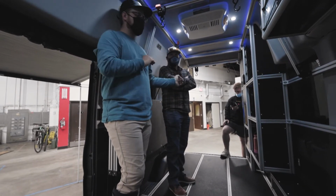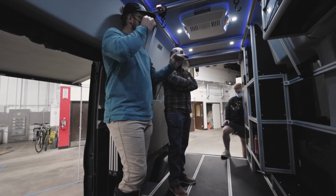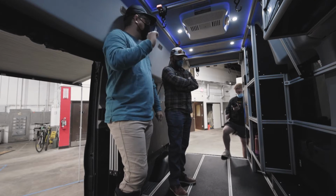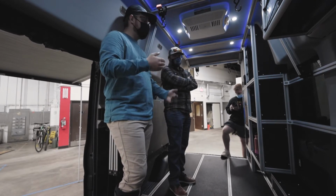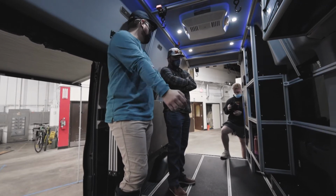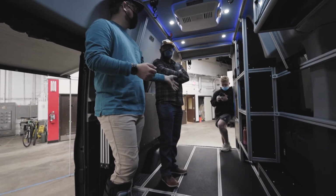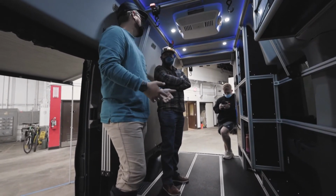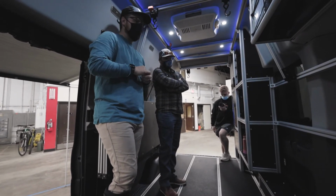All of those are directly tied to Ford. We don't integrate it into our system at all. So the runtime for those will be while the vehicle is on and driving, and then up to about 20 or 30 minutes once you turn off the vehicle, depending on how much power you're pulling from there. If you plug into those at night, regardless if our system's on or off, you will not be charging in the morning. So I just want to point those out first.